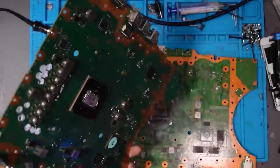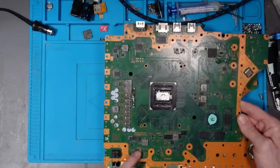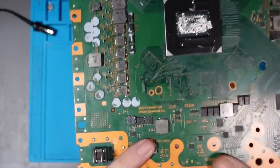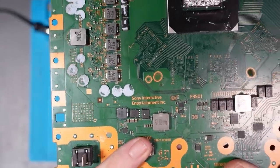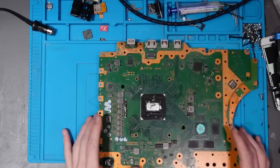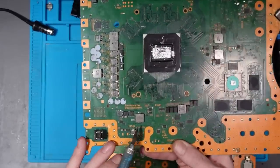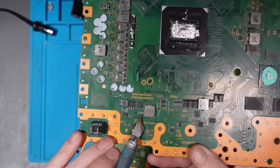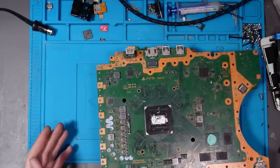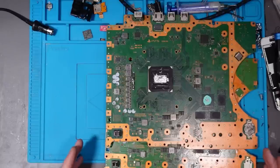The fourth most popular issue on the PlayStation 5 is a bank of capacitors on the APU side of the board nearby to F7501 — there's a bank of four capacitors and an inductor. Generally the third capacitor along tends to fail. I'm not sure why it fails or what the cause is — I think that capacitor might be a little bit weaker than the rest. Usually just taking that cap off or replacing it with one from a donor board is generally going to fix the issue and get it back up and running fairly quickly.